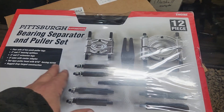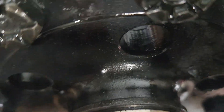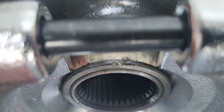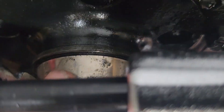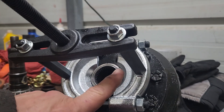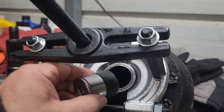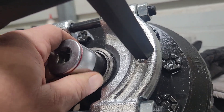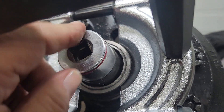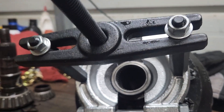There's my Harbor Freight special bearing separator puller set. I'll put it on the outer part - we'll go off this top ledge. Then these will go down inside these bolt holes. Tighten these up once you get it all straight. I've got a socket - it won't fit all the way down in the hole, see how it's beveled right there. Once it starts hitting the splines, I'm going to put a board right there and zip this down. It should pull it right off.